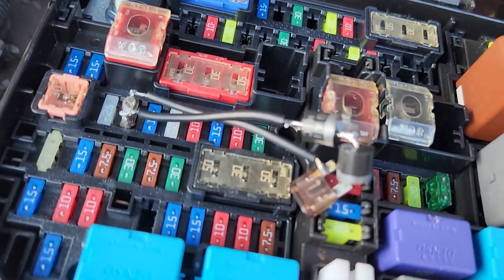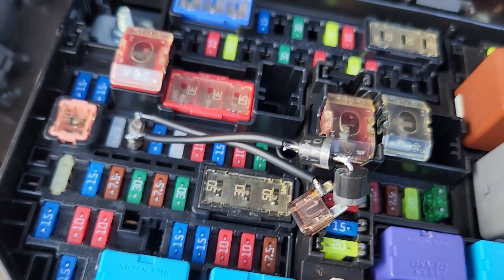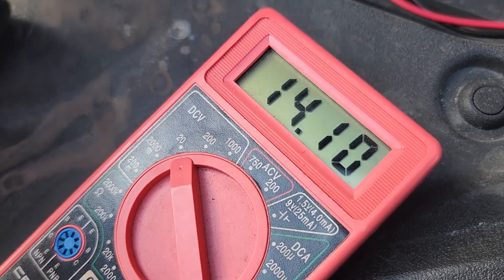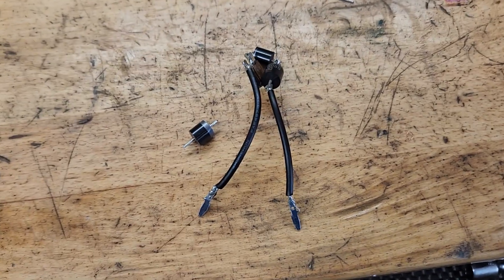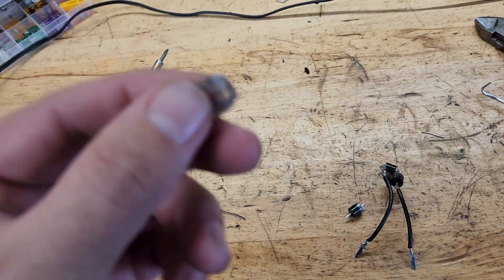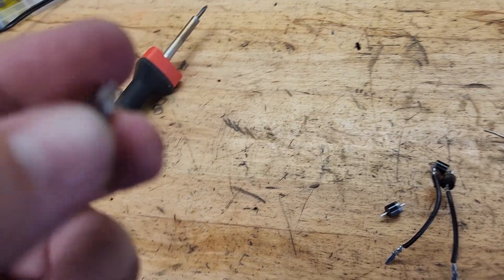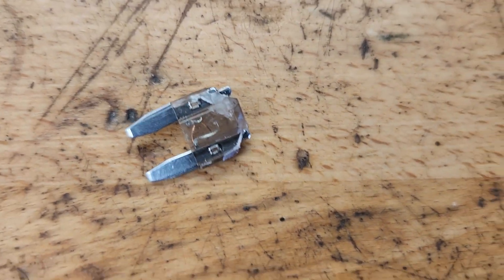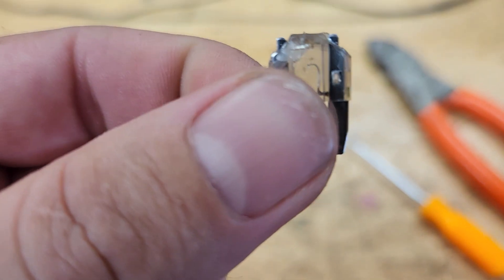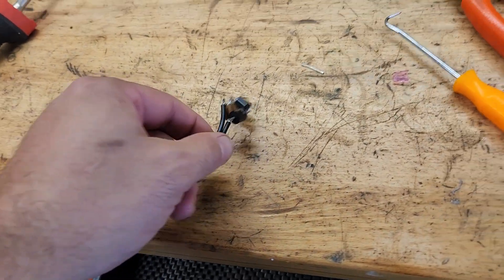I switched out one of my Schottky diodes for another silicon diode and now I'm at 14.1 volts — pretty respectable, that should charge the battery just fine. Keep in mind this is just the voltage at idle; it does go up a little bit once you're running. What I settled on was two silicon diodes wired in series — I just used some cheapo Amazon 10 amp diodes. The reason I included the extra steps is to show you that you can tune it to get whatever voltage you want out of it. It's pretty neat and easy to do as long as you can solder. I'll put a link in the description for the diodes that I used.